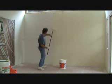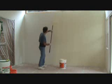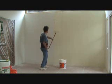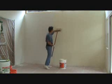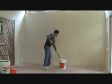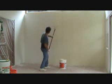You've got to make sure to wipe this edge off and wipe the left-hand edge off and the right-hand edge off after you get the paint on there. Because if you don't, and if you just go straight, then when you get ready to blend it back in, you could have some of the buildup of the paint on the right-hand side, and it could leave a mark without you being aware of it. Okay? That's why you always got to kind of clean off those edges.